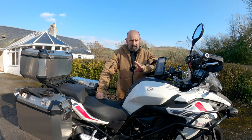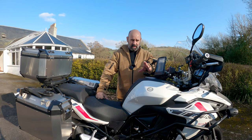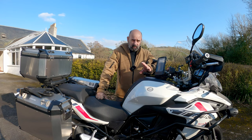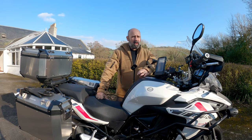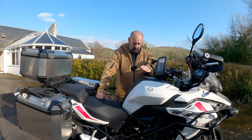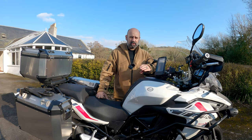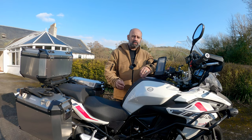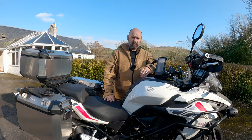Welcome back. This is a very simple job — most of you will know how to do this, however you always have to start somewhere. First thing: always do it on a warm engine. Take the bike out for a run, just five or ten minutes to get up to working temperature, then leave it for about 15-20 minutes to cool down so the oil isn't scalding hot. If you don't do this, the oil will be very gloopy and stuck in the engine. By running to working temperature, the oil becomes nice and thin so all of it will drain out, leaving a clean engine ready for new oil.